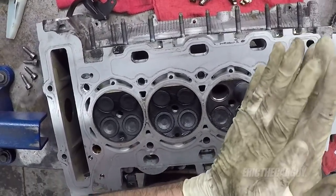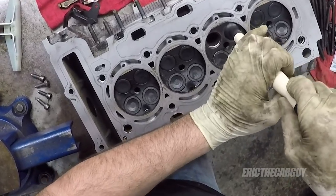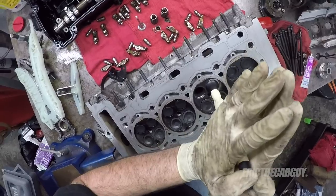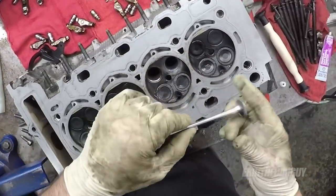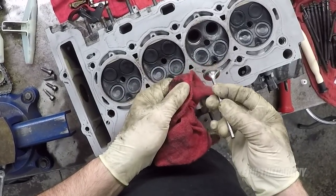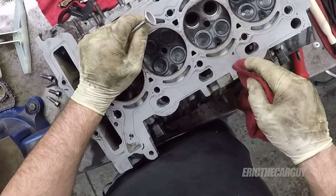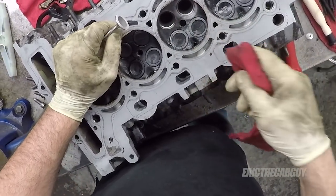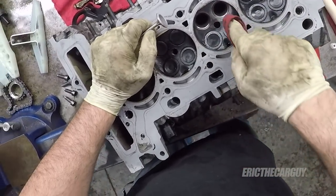Suction cup barely fits on there. This usually goes a lot more smoothly. But you want that dull surface on there. See how it starts out shiny? You want it to be dull. And you also, when you look at the seat, you want to see that clearly defined silver line? That's what I wanted. So despite the fact that I didn't get too many turns out of this thing, I think it'll be okay.